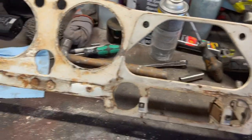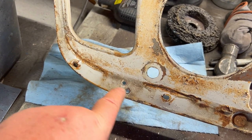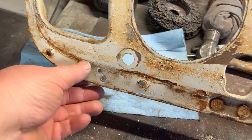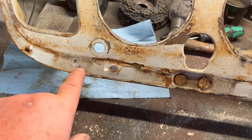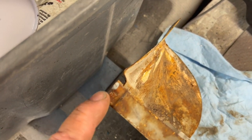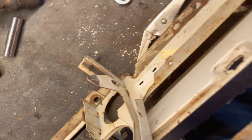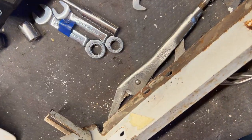A few little tricks here and there but it's pretty straightforward. There are a couple of fasteners up front that are hidden until you actually remove the front crash pad, and these fasteners also hold those vent tubes on the back. On the crash pads themselves there's a little pin in the corner that you need to bend up — basically a little clip. Other than that, you're just screwed on by three screws on the back, and they actually share the screw holes with the hinges for the glove box door in two locations plus one in the corner.